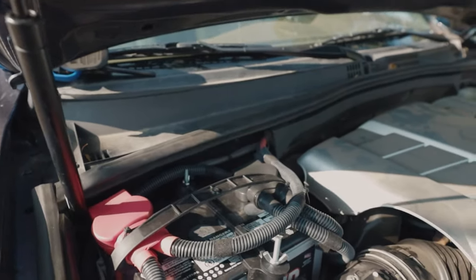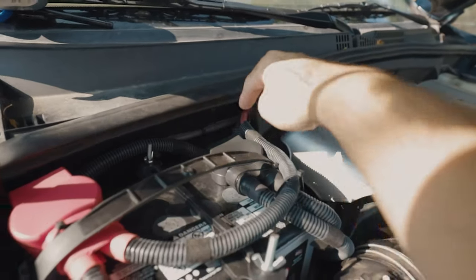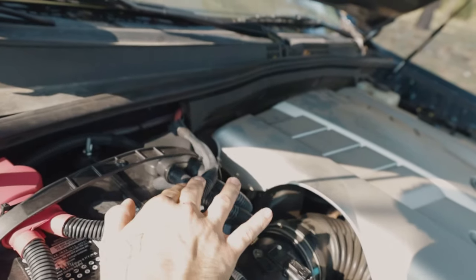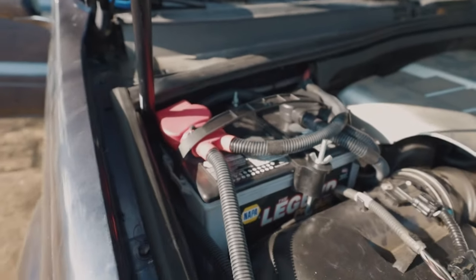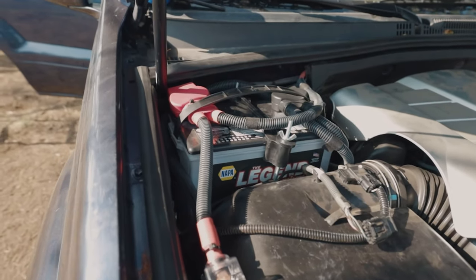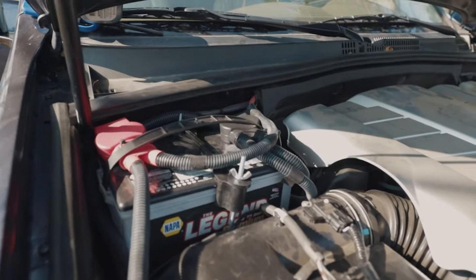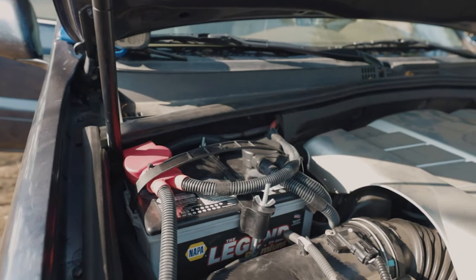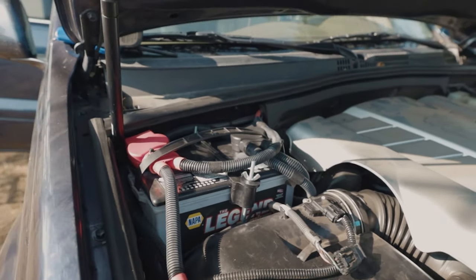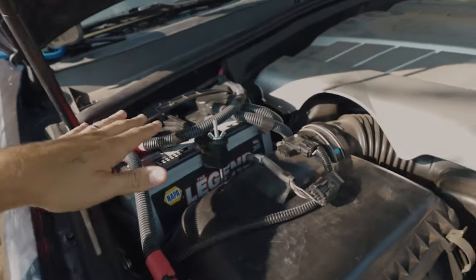The last piece is connecting my fuse box wires to the second battery — positive to positive, negative to negative, as easy as that. I am going to add another midi fuse there; the only reason I haven't is Amazon lost my package. Since it's going to a fuse box that already has individual fuses I figure it's fine for now, but my family is in this car a lot so I'll add that fuse for safety.